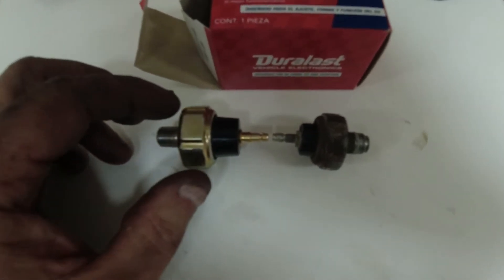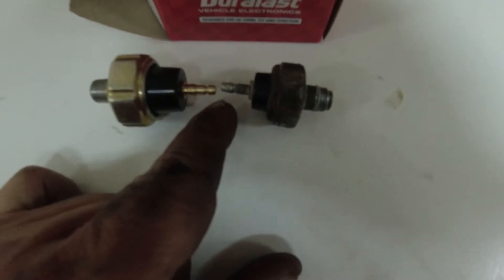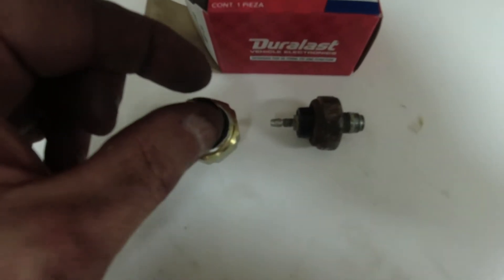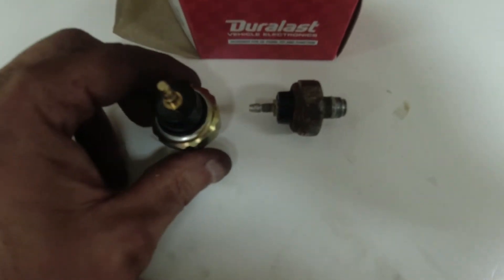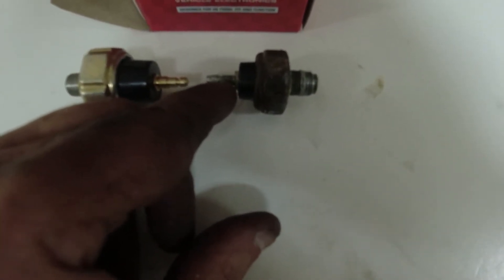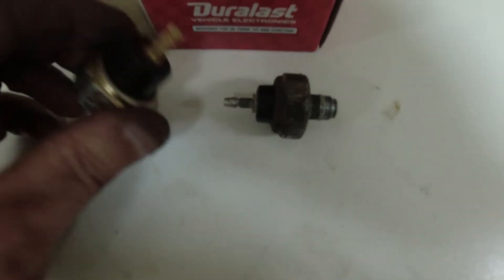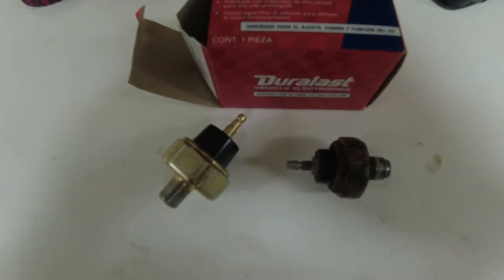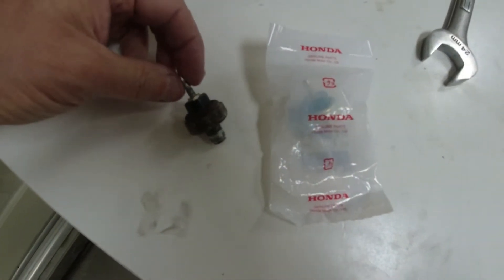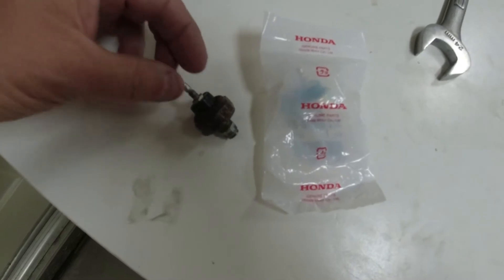This Duralast is not going to work. After I threaded it in, I found out that the OEM tip is a tiny bit fatter than the Duralast. So when you go to push the connector on and try to push it on here, it just wobbles around and falls off — it doesn't even fit. Put it on the OEM one, it's a tight fit, and it actually snaps in that little narrow spot. It just goes click and stays there until you forcefully pull it off. This is not a good replacement. I ended up returning the part to AutoZone because it's too skinny — when I put the connector on it doesn't even snap on, it just falls right off.